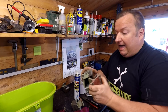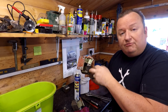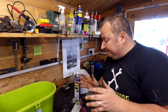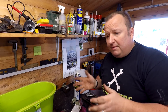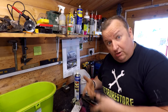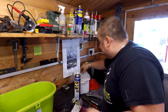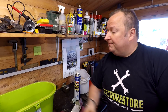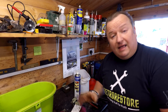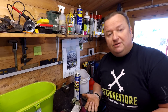Now I'm going to dunk them back in and leave them in there. Now as I say, because we've got a bit of space around that actual pin now, I'm going to leave these in there for another 24 to 48 hours, and that should kill all that rust that you can see bringing up to the surface when I lubricate it. This actually works very, very well. Someone mentioned some other product in the comments that works very well as well, but it's also 10 times dearer than vinegar. Molasses is good for a long period of time if you're leaving parts to soak. Vinegar — this is just white vinegar — works absolutely superb for cleaning stuff, and it's going to be ideal for cleaning things up like these nuts and bolts. Just chuck them in there. Anyway, that's enough of this today — I thought I'd just show you an update on how I've cleaned these up. Hopefully if you've never tried it, get yourself some. If you've got a couple of days to wait, just bung your nuts and bolts — anything really — and that will eat the rust just like I've shown you. Thanks very much, see you in the next video. Bye for now.